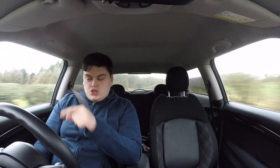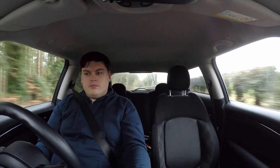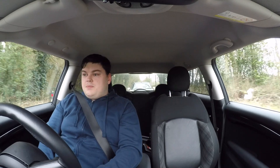Basically I've got a new set of brakes, I've installed them, and I've done just under 250 miles. The bedding-in procedure requires 250 miles of steady urban driving between 30 and 50 miles an hour. So that's what I've done. Now we're going to go and get these brake pads properly bedded in.